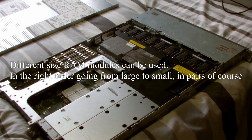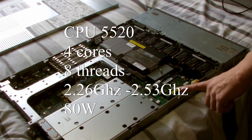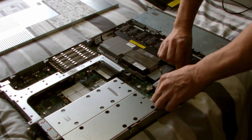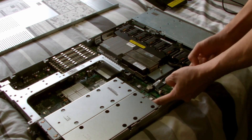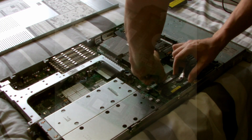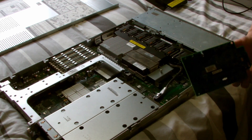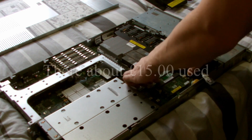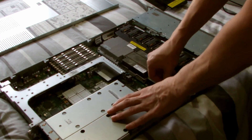The processors I think are 5240s, and interestingly enough on this server board is the SAS card which isn't actually PCI Express — it's got these little clips in here. There's no battery backup, that's missing from it, it just clips in. So as you can see you couldn't really fit anything else on here to replace it — we'd have to get an original OEM part.